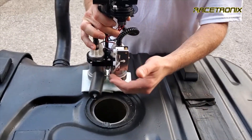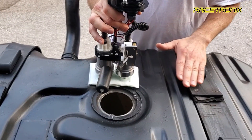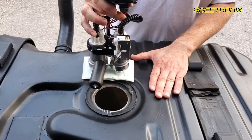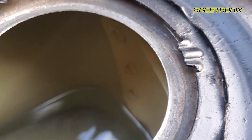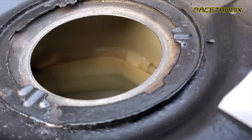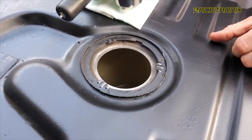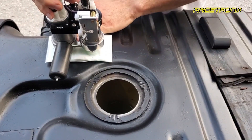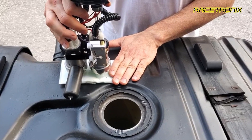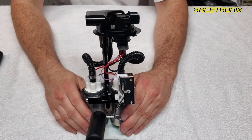The position of the level sensor has to be towards the front of the car, and the pumps have to be at the back side, from left to right, so that it doesn't interfere or hang up on the baffling in the tank. Inside the factory tank, towards the front there is a lot of real estate for the level sensor to go up and down unimpeded. Just below the hole in the tank, there is enough width for the filter socks and the pumps. Under hard acceleration, all that fuel is going to go to the back of the baffling, and that's where you want the pickup socks for the fuel pumps.